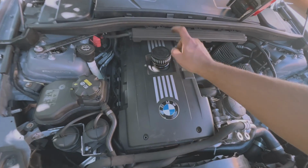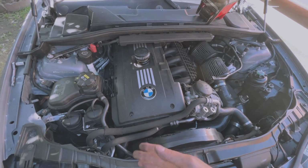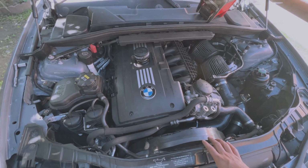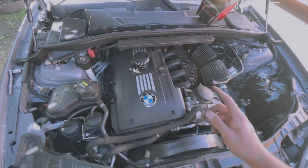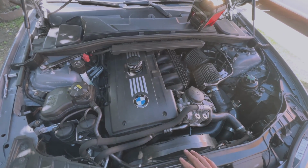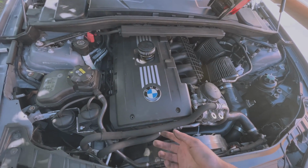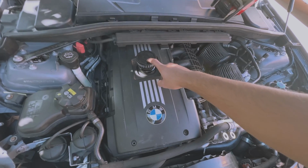So I would highly suggest getting this, because I'm on upgraded 17Ts on eBay. Check out that video. Very good turbos. I'll make a separate video about that. But the main reason, like I said, upgraded turbos, make sure to get these, because my oil pan gasket is leaking and I just replaced it about 20,000 miles ago. And I'm pretty sure it's due to the fact that I'm running 22 psi and I do not have this.